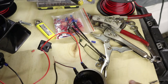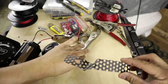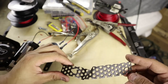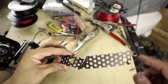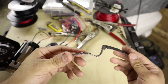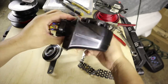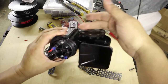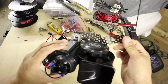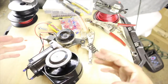Before going to the bike, I'm going to install a custom bracket I made for the air horn. It's just a sheet metal bracket with lots of holes in it, which makes it easier to work with. You'll need to make a hole big enough for the air horn. There's a bit of a bend in it to accommodate the position on the bike — the horn will face forward toward the front of the bike, with the bracket going onto the bike's frame mount.